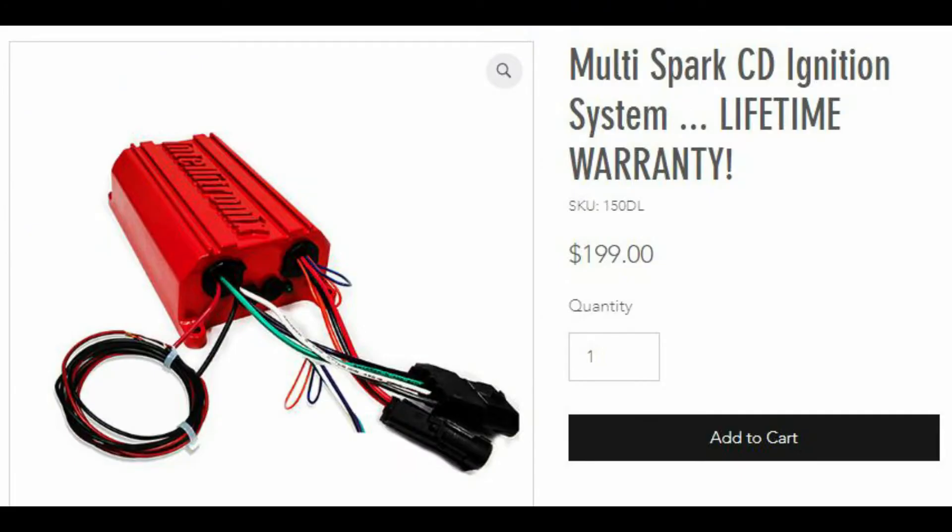These are the things I really like about the Intellitronics ignition box. It's a multi-spark box, very much like the MSD in function. It also has a built-in rev limiter that you can adjust by hundreds and thousands, all the way up to almost 10,000 RPM. It has built-in fail safes so that if something shorts out in the system, your distributor goes out, your coil screws up, or you get a voltage spike, it will actually shut down and protect itself so it doesn't get damaged.